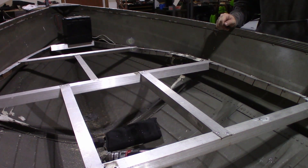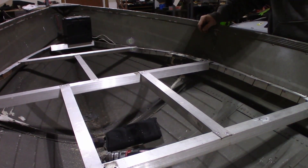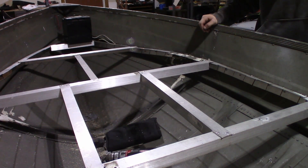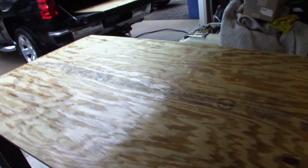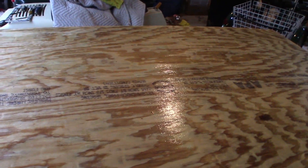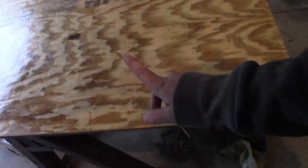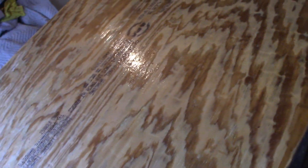The whole floor is reinstalled now. We just have these little end pieces on the side — I'm not sure what I'll do with those yet, but I guess we'll find out. For decking, we have this really nice piece of pressure-treated lumber. You want pressure-treated because it is water and fungi resistant, and in a boat that will be receiving water all the time, it's a good idea. We got two sheets, because we're going to build a dashboard and everything in this video. We need to cut it to 50 and a half inches.